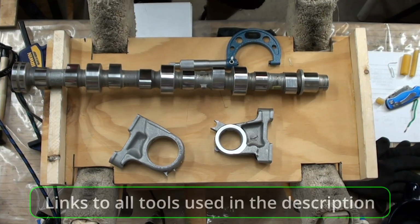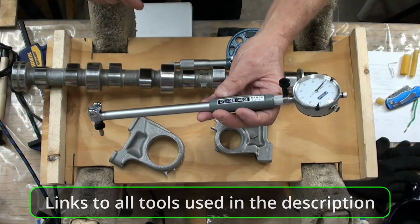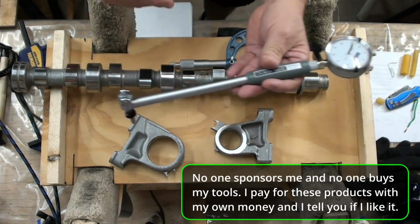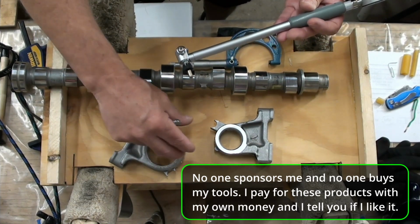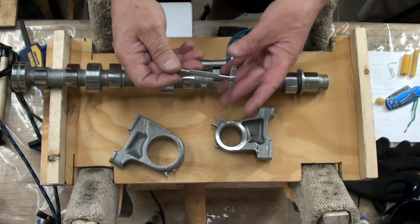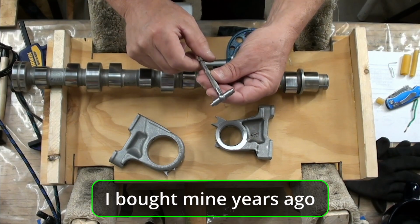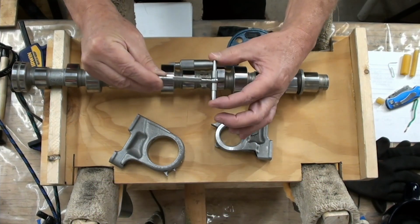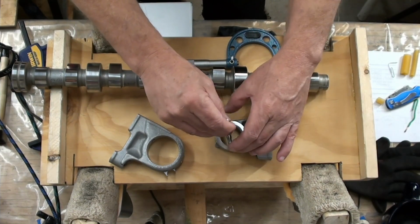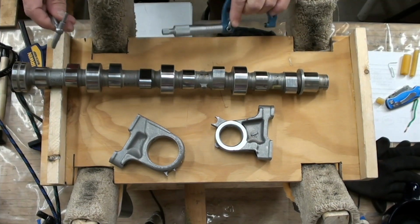First off, I'm using a bore gauge. This is a Fowler bore gauge, and it's fairly accurate, 0.0005, so 5 ten-thousandths. But this is 1 1/4 to 6 inch. Unfortunately, it doesn't fit the small one. So you have to use a snap gauge or small bore hole gauge, whatever you want to call it. This is Starrett. I purchased a 4-piece kit. I've got a link in the description. These are very nice tools. This is self-centering. You can see this thing moves in both directions, this way and up and down. That's how you have to measure this little guy here, and then your micrometer. You only need a 1 to 2 inch micrometer for measuring all of this.